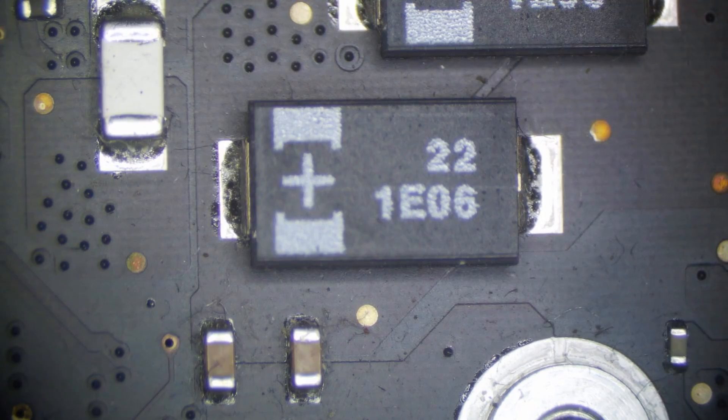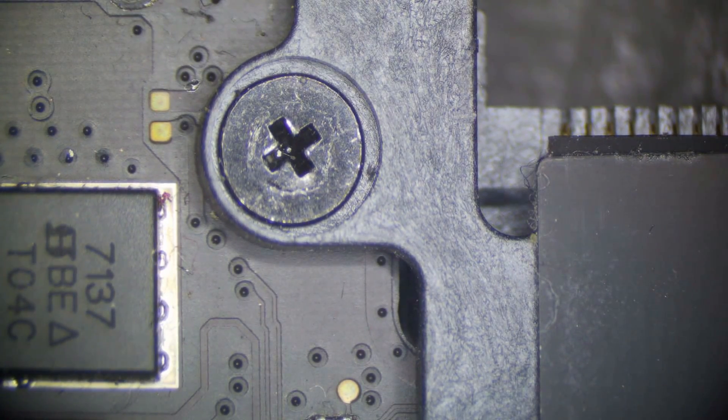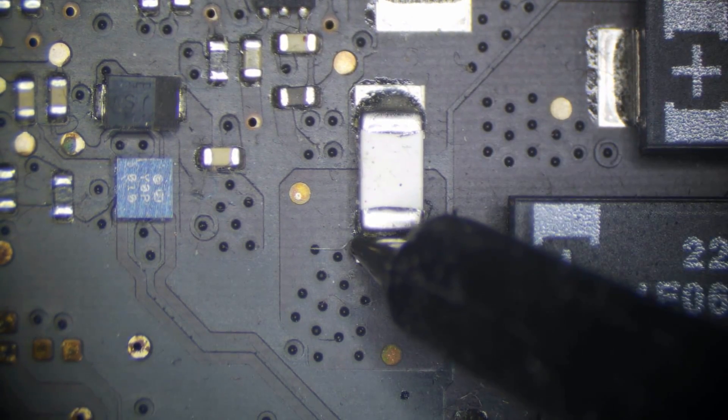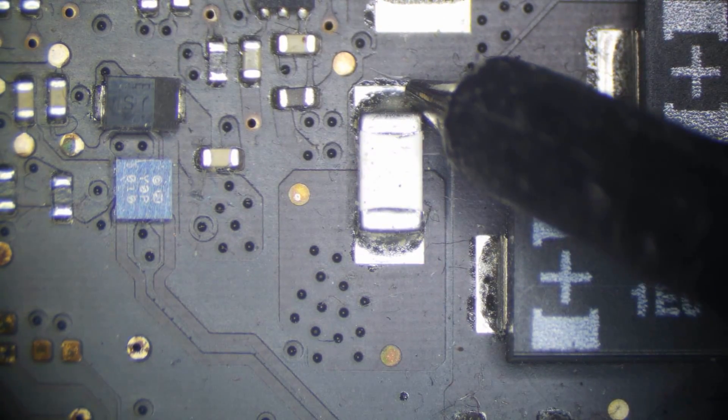Let's go ahead and put a new DCM board on because the old one doesn't look right — we're not going to let that happen here. We actually get a green light on the charger, which is pretty surprising. PP bus shows up on this fuse right here, and PP bus is 12.32 volts — so those MOSFETs are actually okay. That's ruled out. We're going to go ahead and replace the ISL6259 and see if it still kills our battery.